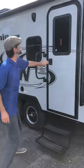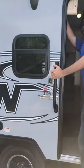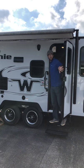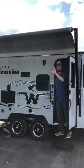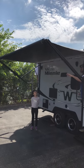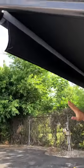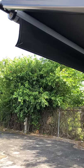I'll go in here and extend out your awning. Always want to make sure your door is clear when you open up your awning. As an indicator to let you know when you're at the end of the awning — it will not stop, it will keep rolling — when this skirt piece falls down, that lets you know you're at the bottom. Plus you'll see the bar is exposed, so stop it at that point because if you continue to hold down the button, it's going to roll it upside down.